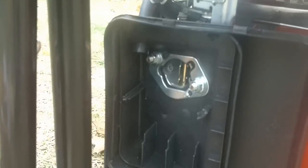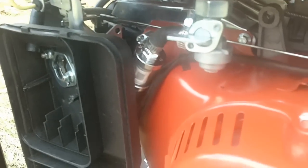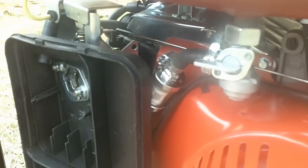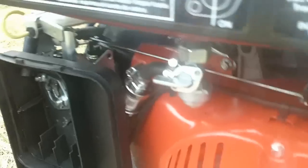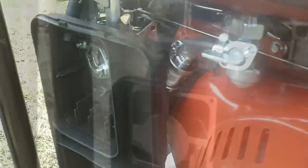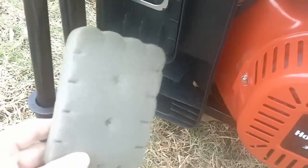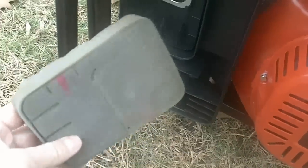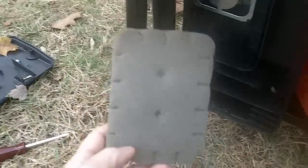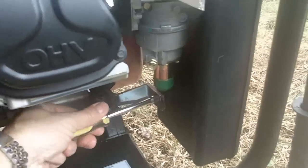These gaskets were in good shape so I'm not going to change them. We've got the filter cover back on and we've torqued down the screws. As you can see, the gas filter is nestled right in there — not too bad. There was a little plastic piece that used to hold the hose that I had to snip off — no big deal. The filter fits in the filter guard, and here's the foam filter. This is a great time to look at the foam filter, to clean it, and to put oil back in it before you reinstall it. This thing needs to be soaked with straight 30 or 40 weight oil.